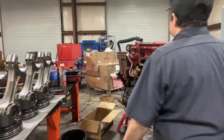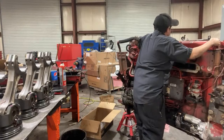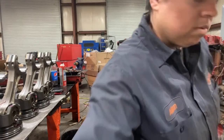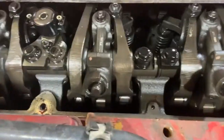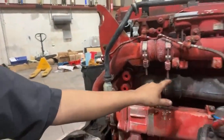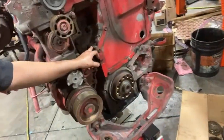This is the one that came out and it's really bad. I'll pop this cover up so y'all can see it. If y'all can see down there — that roller right there on the end is all chewed up. Most of his are like that. He has six broken manifold bolts, four right here. Like I said guys, he just bought this truck. Y'all need to look for stuff like that — for an exhaust leak you need to look to see if it's leaking in the rear or in the front. Y'all need to look at all that before you purchase a truck.